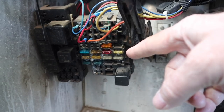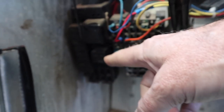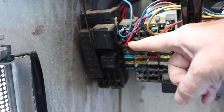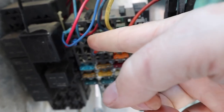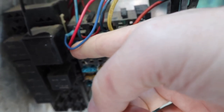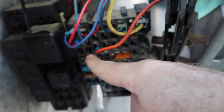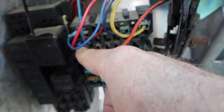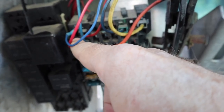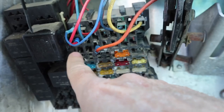I've gone through and pulled out all of these fuses and all of them are intact — not broken — so they seem to have good connections. What I've not done is check these relays over on this side. There's a whole bunch of relays here and I'm not sure how to check relays. These wires in this one area — this blue wire, this red wire, this other blue wire, this brownish-orange wire — these are the ones having problems. Whatever feeds the power or the ground for just this area is what's causing the problems.